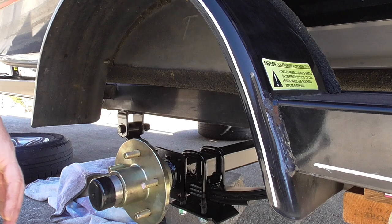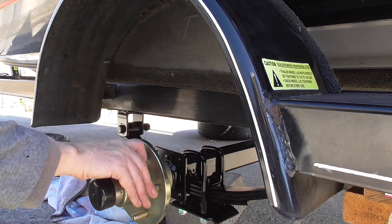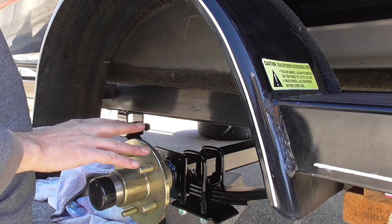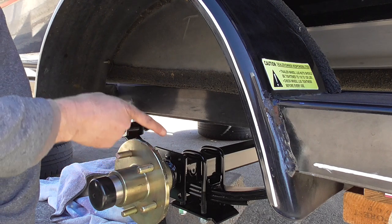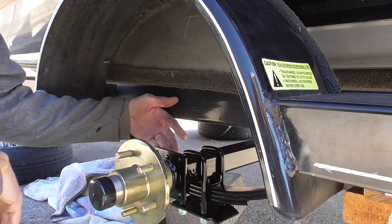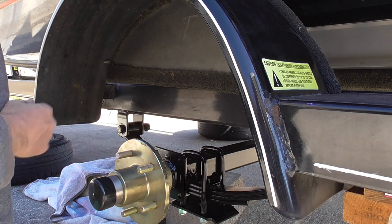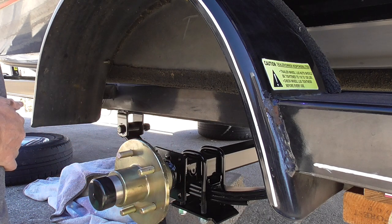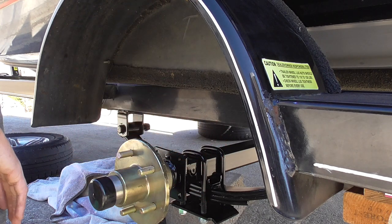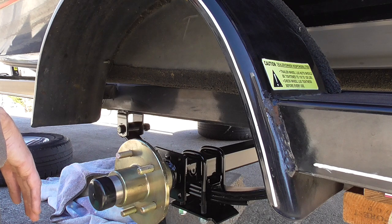This is probably a good time to mention that I'm not putting brakes on this right now, though earlier in the video I was seriously debating it. I'm planning for the future — if I ever do want to add brakes, I had them put a brake flange on this axle. This little thing with four holes back here means I'll be able to replace just the hub with a brake hub assembly whenever I want to.